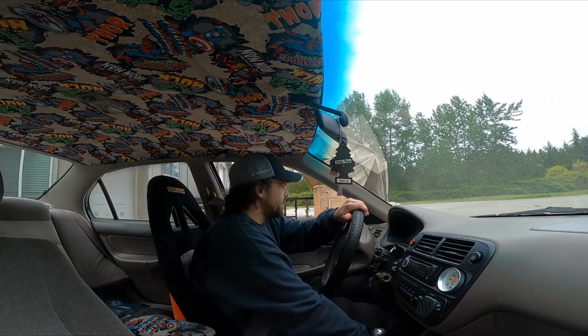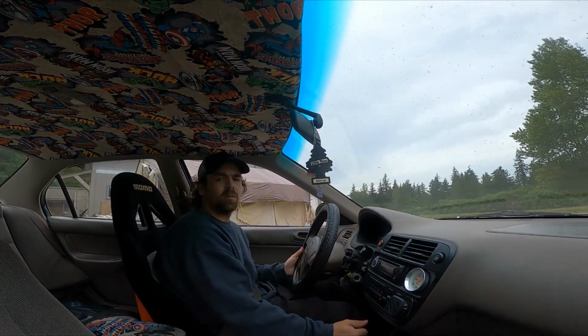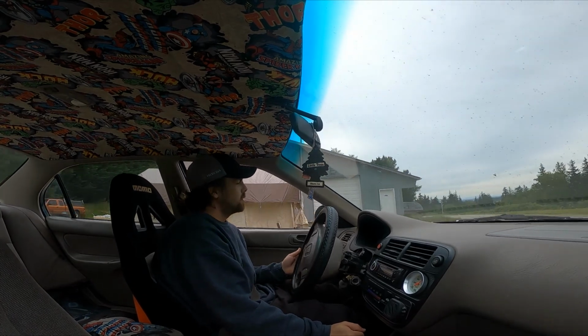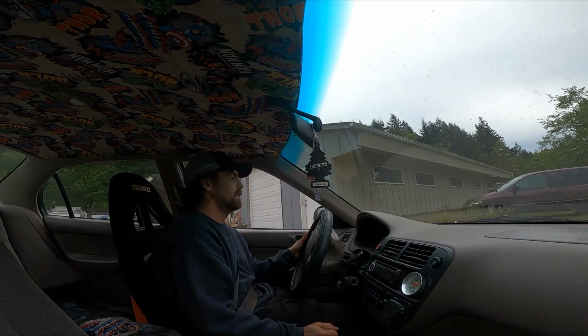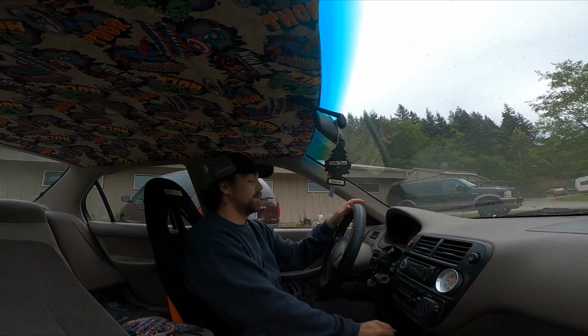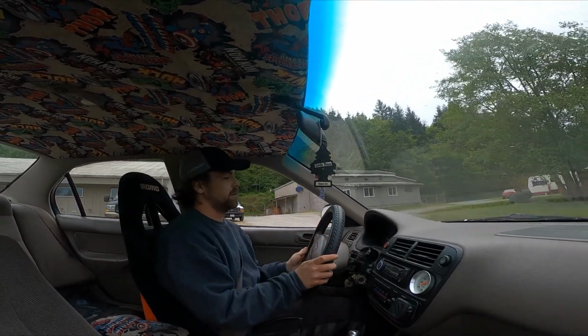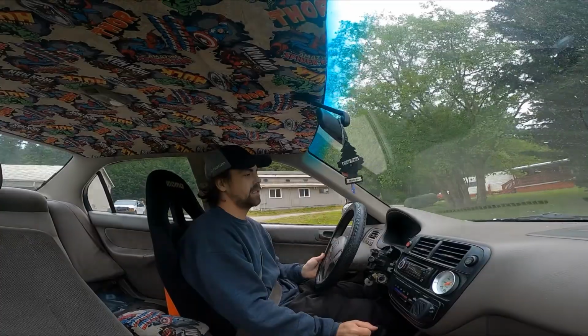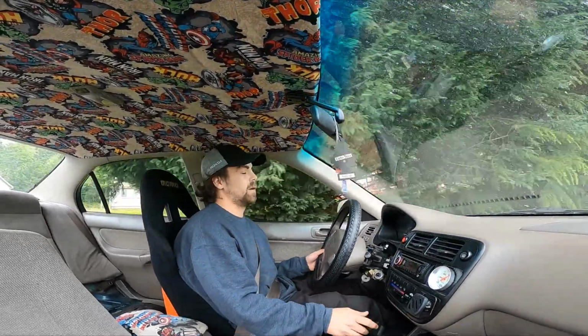Be the first test drive, don't tell Anthony. It's okay. We gotta make sure it works first. So the tune does need to be squared up. My wideband is coming. It's supposed to be O'Reilly's here, or my oxygen sensor. It's supposed to be here in about an hour or two, but we're not going to do anything crazy. The tune's rich, I can tell you that much, so I think we'll be okay.